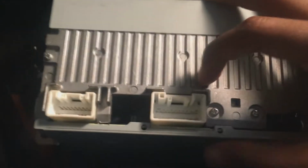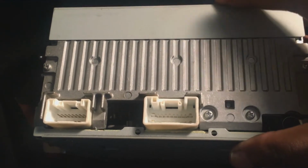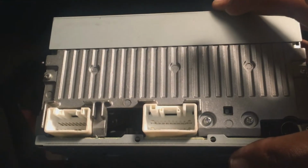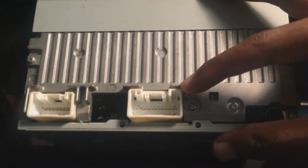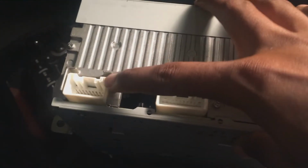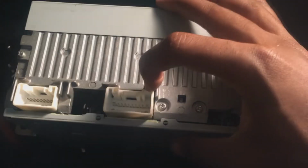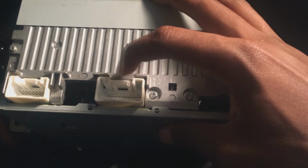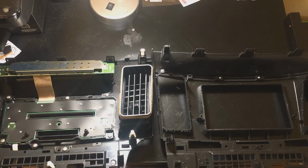So I found a diagram online that helped me find this out. So what I'll do is I'll post a picture of it right now, and then I'll also leave a link to where I got it in the description, just in case you guys want to save it or need it for later. But yeah, that's basically that. So we're not going to be using this one anymore. We're only going to be using one cord. And so we're just going to start soldering so we can get that all prepared. So all we'll have to do is plug in the new radio and put it in there, and we'll be done with this.